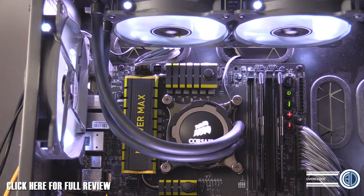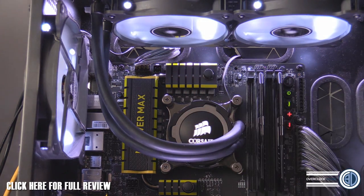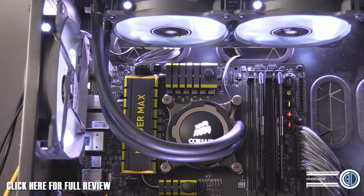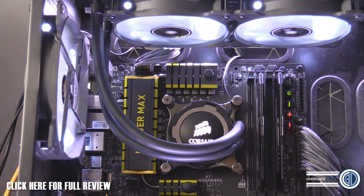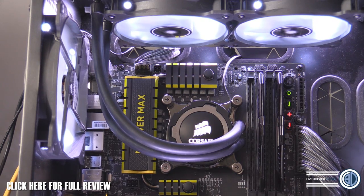This is, in my opinion, such a bad idea that it would actually have been a better choice to leave it off completely. I'm going to be significantly marking it down because it's so restrictive. A half-inch barb would have been bad enough; in an ideal world they would have just put a G1/4" thread on it. Having that tiny barb with no choices of fittings, colors, or angles — it's just bad thought and implementation. Whoever designed this obviously doesn't particularly understand water cooling and what the market actually needs.